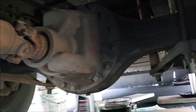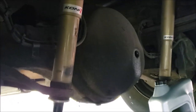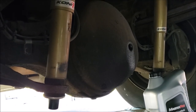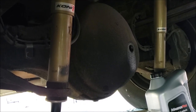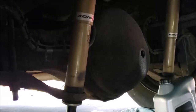It is just a huge bell housing on the back of it. Here is the back side of the differential — you can see how the check plug is on the very center of the rear, where on the Dana S130 it's up front on the side. I'm fixing to change oil on this thing. See how black that oil was?